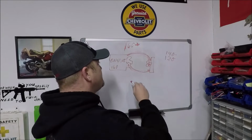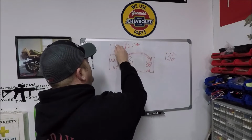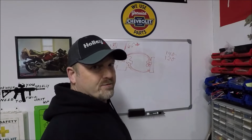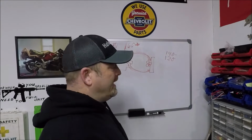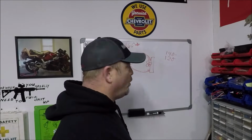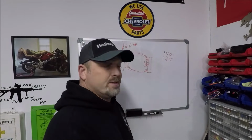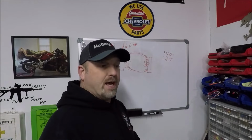Okay, so this is why I said in my last video that I actually prefer to run a 180, because most well-maintained factory cooling systems are capable of running at 180 or 185 degrees. It's kind of an in-between point between the 160 and the 197, and it allows your cooling system to operate properly, point blank. Now, you can argue with this logic all you want. It doesn't change the facts. This is how your cooling system works. This is how your cooling system reacts when you take the thermostat out or you run a lower temp thermostat. That's just how it is, guys.